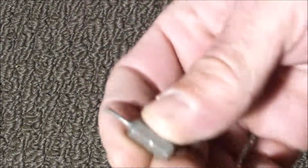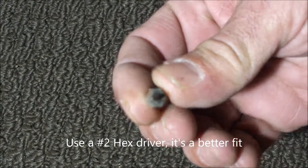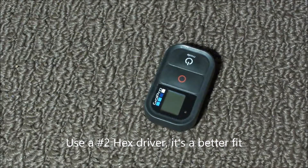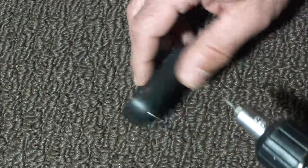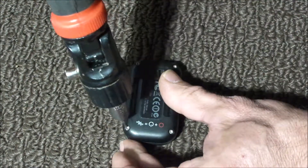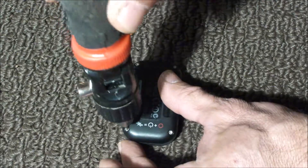Not very difficult. A 1.5mm hex driver bit is the first thing we'll need, and of course I've got a Momonga screwdriver to do that. But what we'll do is get these four screws out of the back.